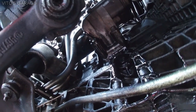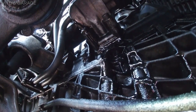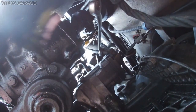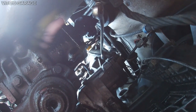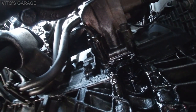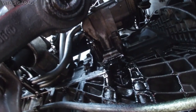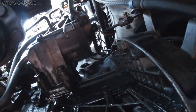I'm under the car. As you can see, there's the oil filter housing and it has a lot of leaks — that's because I loosened the oil cooler lines. Here's my 12-millimeter line wrench; I'm going to loosen that oil pressure line. Then I have about five or six six-millimeter allen bolts to remove. After that this thing is going to drop, and I also have to loosen that oil feed line to the turbo.